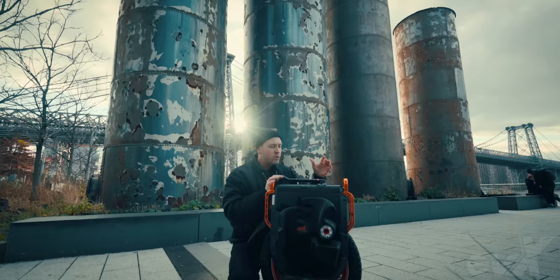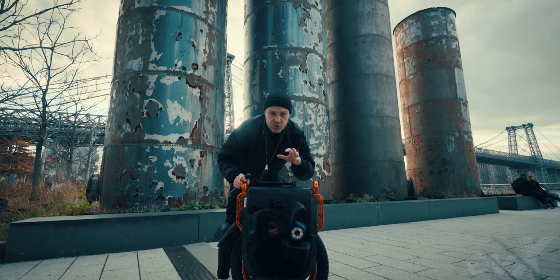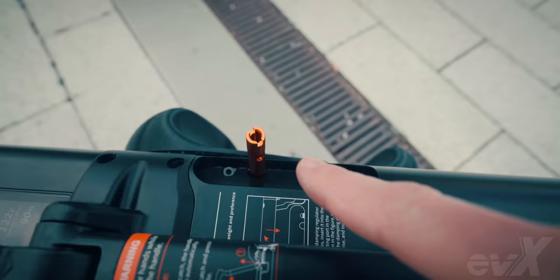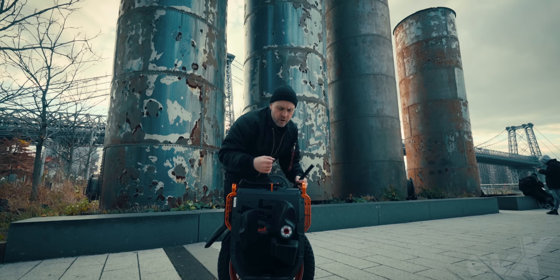But in general, you have the pump at the bottom, fill that up, then you have this dampening right here at the top. With this dampening, basically you have these little soft pads that you pull up, these little rubber things. You pull this off, then you use this little orange thing they supply you. It slips right onto it, and then you twist this, and there's one on each side. So adjusting clockwise or counterclockwise will determine whether it's more engaged or less engaged, or a stiffer or softer dampening situation for your ride.